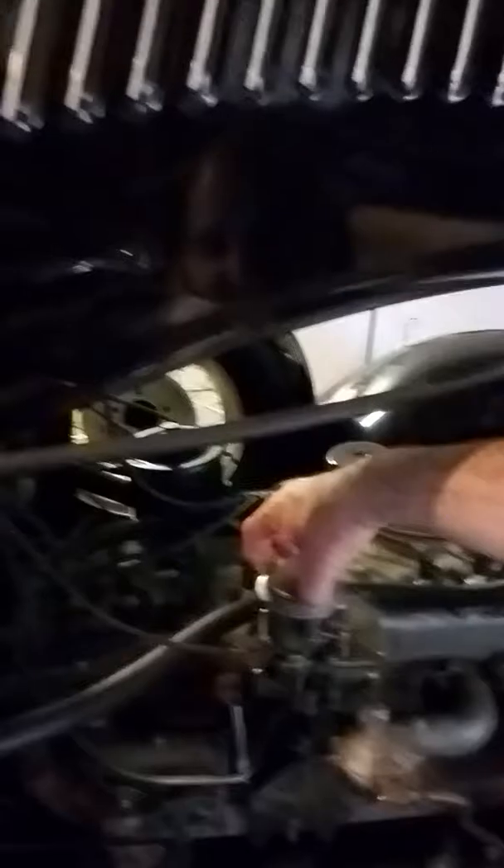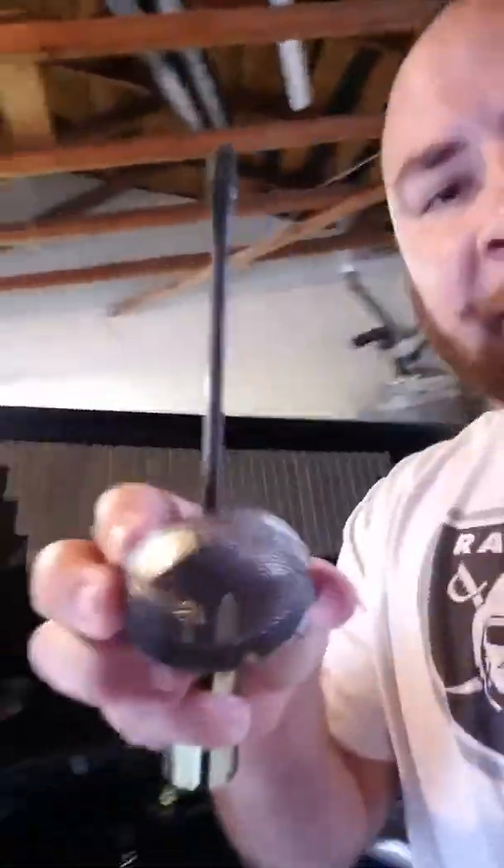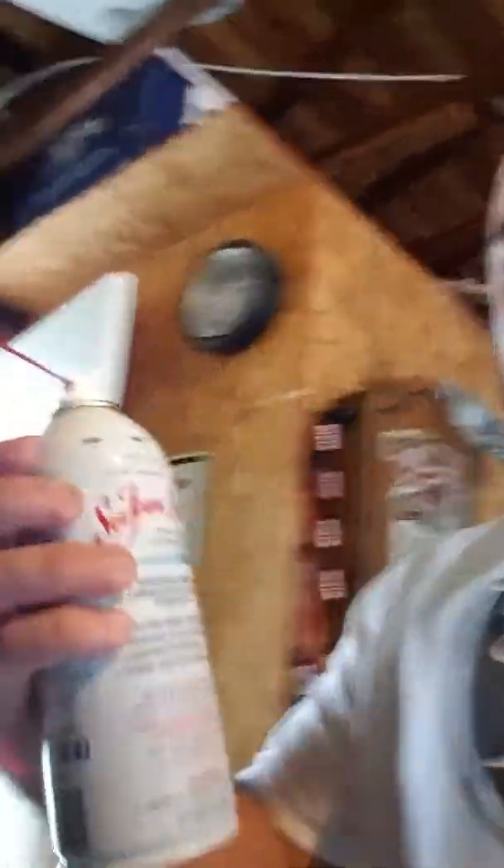So now what I'm going to do is pop off the intake here, which is a bit of a chore because it won't come off easily — screwdrivers are needed. I want to pop off my little intake here. There we go — little screen intake, nothing fancy, just something to block stuff from going into the motor. What you do is take this SeaFoam spray and throw it into the carburetor like so and spray. Some people like to go direct and just cut out the center, but I'm going to leave that little bend in. I'll be doing a tutorial on that next — follow that on my page. Thanks for watching.